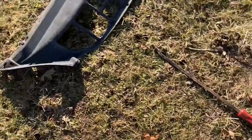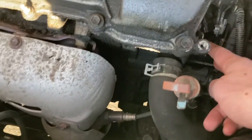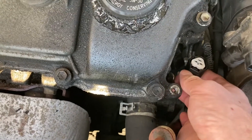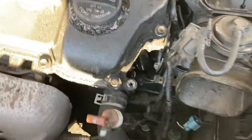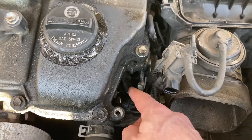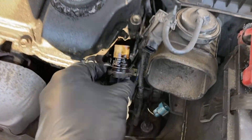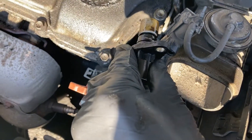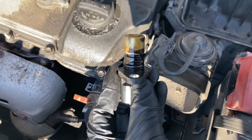Taking off this air duct right over here by removing the cover. You have a few clips — they just push out. Then from the left end, wedge the connector which is right over here. You can press in on this side and that's against the wall right there. The connector has a lot of oil in it — it's wet right over here, and this side is also wet. This is the sensor once you pull it out — as you can see, it's all oiled up.